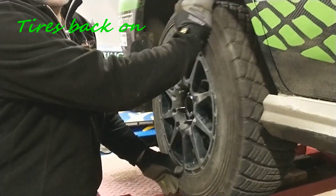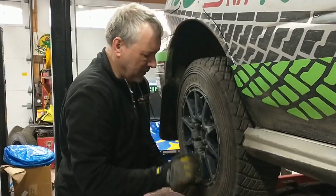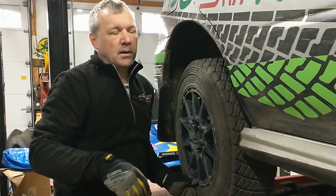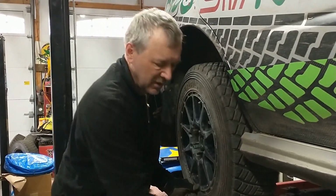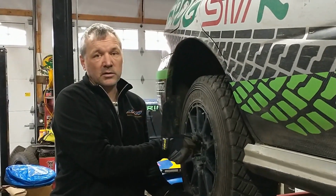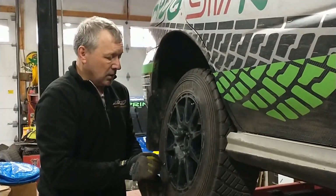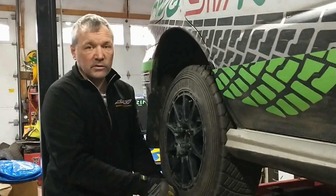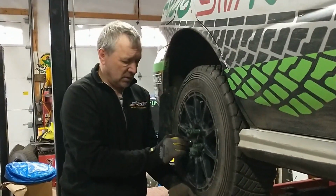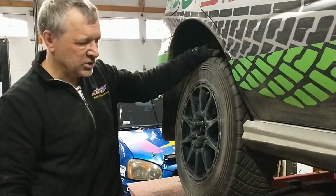Gravel tires, we run 30 psi hot. So even if the pressure is at 28 and it's cold, you don't have to put them back on at 30 psi because they are going to get back to that pressure as soon as they get to 10. We want to make sure we catch slow leaks, so as soon as the pressure drops below 25, we need to put more air. If it consistently keeps going down, we change the tire.